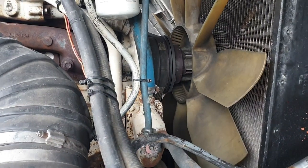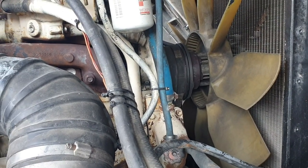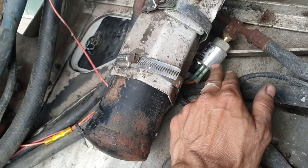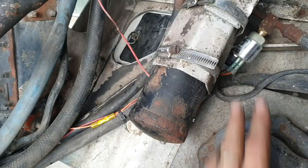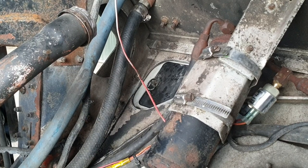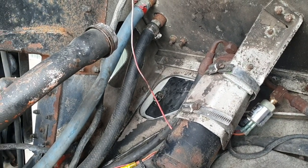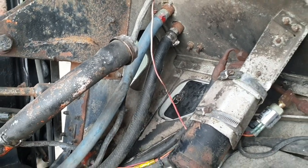And the heaters are constantly on hot, which is all right, but when I come to regas my aircon, by the way, I've fitted a new high pressure, low pressure switch, because that was all rotted out. So now, theoretically, in terms of the air conditioning, it should just need regassing. But it was pointless getting it regassed and then expecting the aircon to blow cold if I couldn't turn the actual heaters down.